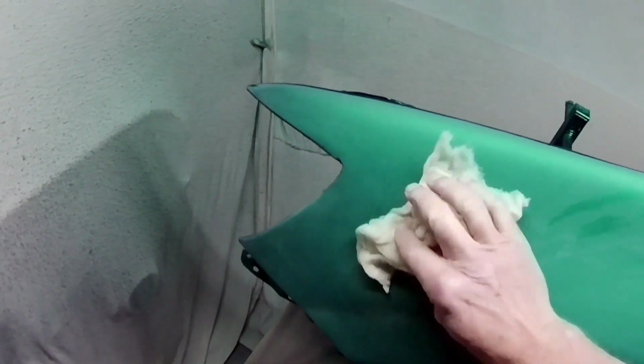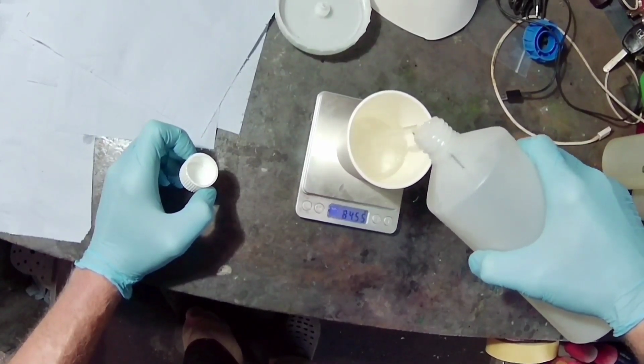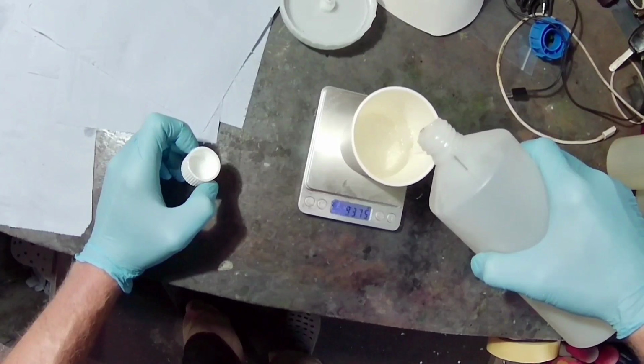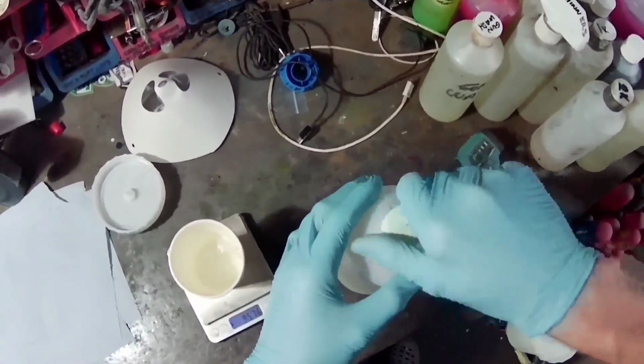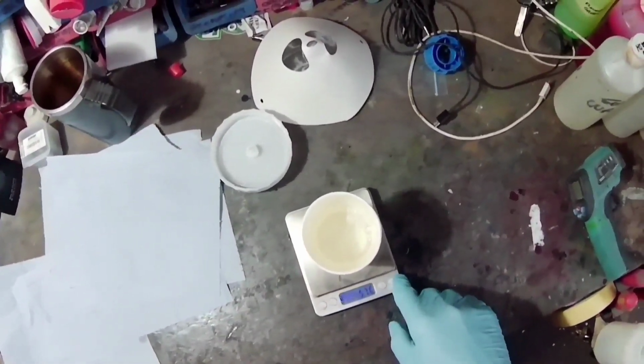You compare that to, say, an SRI Pro Light or Pro Light S, as they're called now, same gun, about 3.8 CFM for the TE5 cap, and the HV5 cap is about 4.8, I think, CFM, but that's at 2 bar. So you can see that these things are not using a lot of air at all. So if you've got a small compressor and you've got a few panels to do, we're seeing here that it's quite possible and not particularly difficult either.